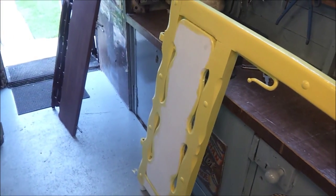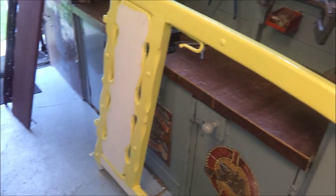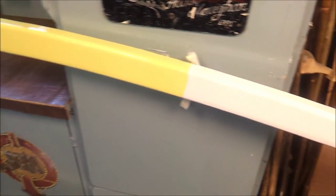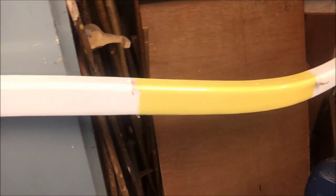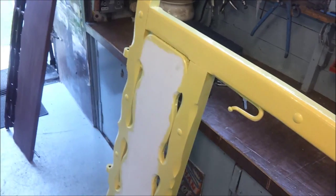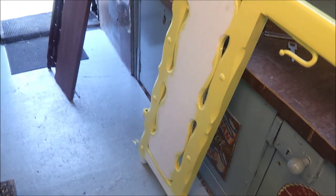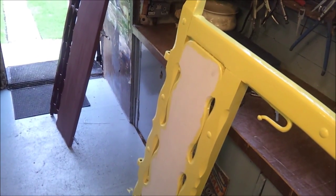The shafts are glossed up now. They've had their primers and undercoats and gloss, and I'm going to do the patches that you can see there with a maroon coach paint to match the maroon on the body. I'm also going to do the footplate with maroon, pick that up with maroon, so you'll see the gold leaf better when the footboard gets glossed.